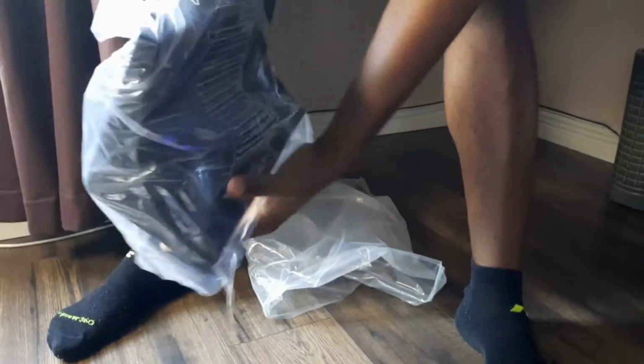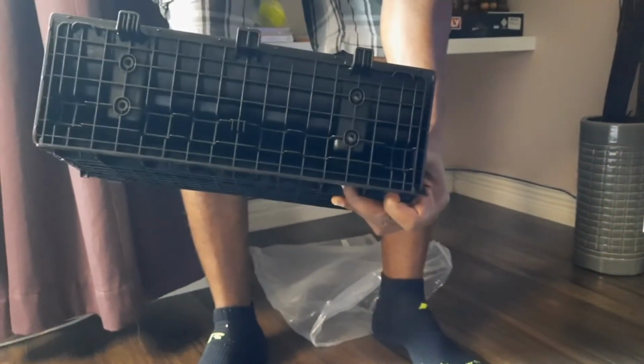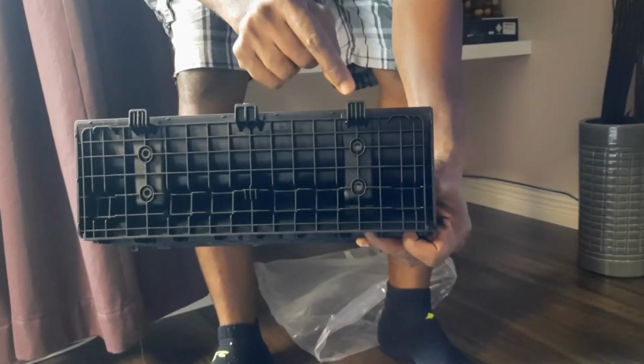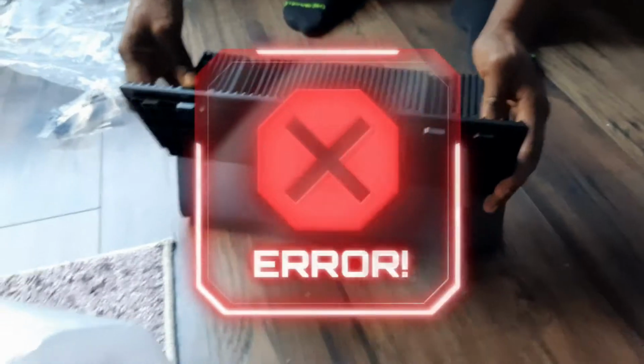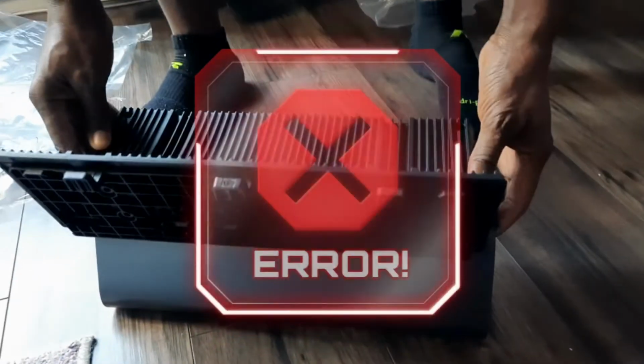Alright. So when mounting the plastic on the metal bar, it's very important to pay attention to this. Remember the holes I mentioned, they should be connected to the iron bar. That's the sturdy part. Those hooks that you can see on top will be connected to the top of the iron bar. You can see if you fix it this way, it's not going to work. It won't be sturdy, it will just be wobbling. So please remember not to do that if you don't want to damage your TV.